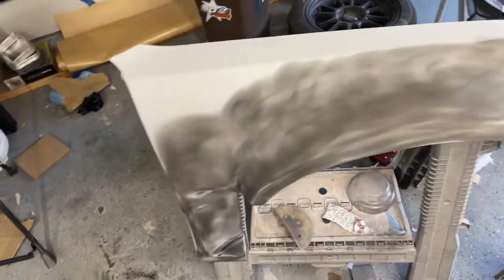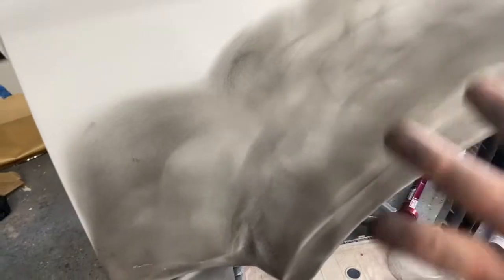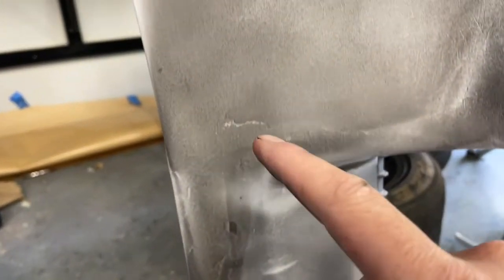We're resuming slightly after the last video. I did spray some high build primer on the fenders, which highlighted where errors were. I'm getting a little tired of working on them and just want this project to be done, but I'm trying not to half-ass it. So I've already touched up one fender. The second one has high build primer on it, and I rubbed guide coat all over it - the idea is it's going to show me any highs and lows and any big scratches, and you can see right here it highlighted the areas that are uneven and need work.